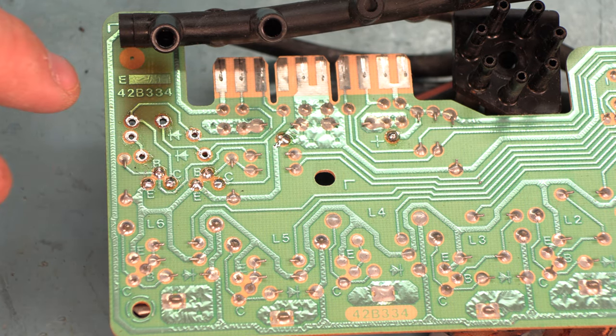Next, let's test this. The first purpose of the programmer is to drive the blend door motor. To test that, we're going to set auto mode and choose a 60 degree set point. We should see the blend door motor move toward the cold side, which is up — it's at about the 10 o'clock position. Next, we're going to choose full hot. We want to make sure the blend door motor moves to full hot, which should be about the 5 o'clock position. That's somewhere between 4:30 and 5 o'clock. Next, we're going to choose a temperature about halfway in between and we should see the blend door motor stop somewhere between those two — and we do.